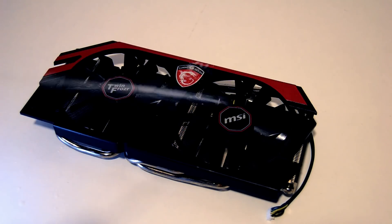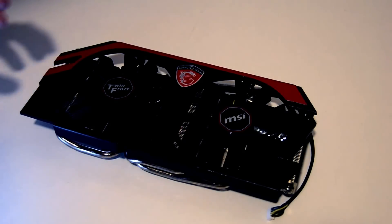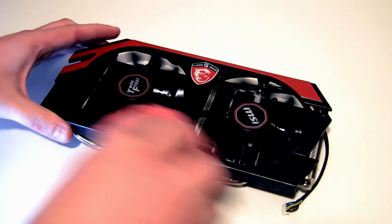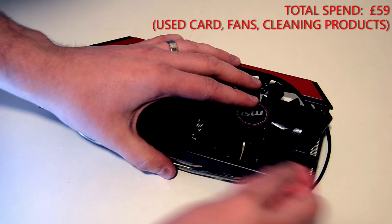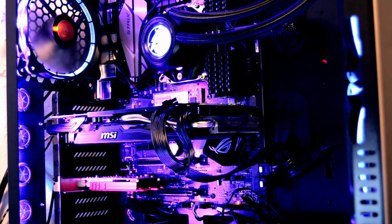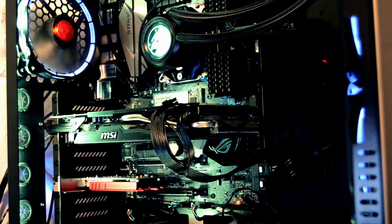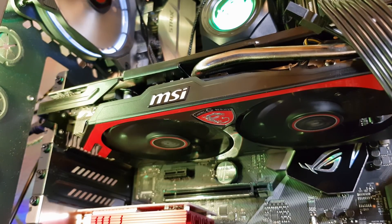By the time the new fans arrived, a week or so later, everything was looking pretty much spot on. With the new fans ready to breathe new life into this fresh looking 285, reassembly was simply a reversal of taking it apart, remembering to add some new thermal paste onto the GPU itself. After a little bit of elbow grease and less than 20 quid on new fans and cleaning products, I ended up with a nice clean 285 that set me back £59 — just over half of what a retailer like CEX would charge. It boots perfectly, it's solved the overheating issue, both fans are spinning perfectly and really quiet. The removal of all that dust and grime and replacing the thermal paste means this card is as factory fresh as a three-year-old card can actually be.